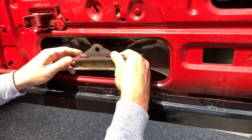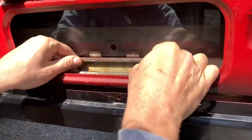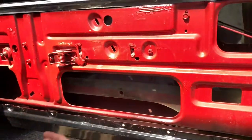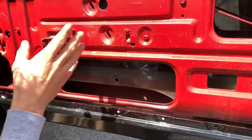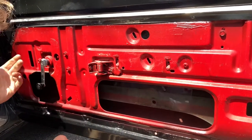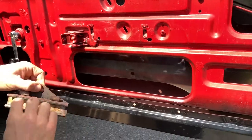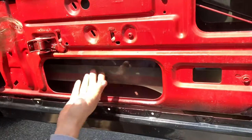Originally, how this works: this channel needs to be in here, and that plug secures it. But before you do that, you need to have the crank arm of the window regulator in the channel. I don't see the crank arm anywhere. There's a regulator here, which is the crank — you're familiar with that when you're driving the car. When you twist it, it twists the gear and there's an arm that comes down the rest of the channel and operates the window. I open this up and I don't see the arm — it's up here.